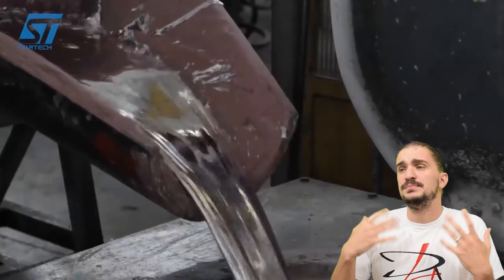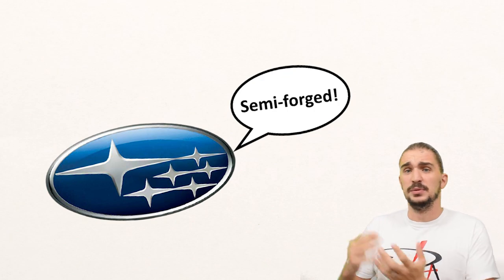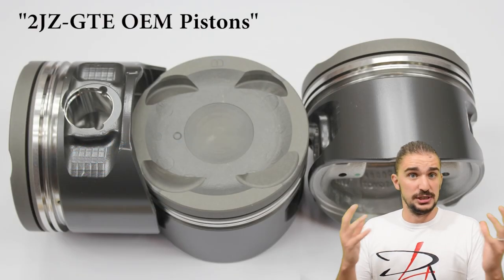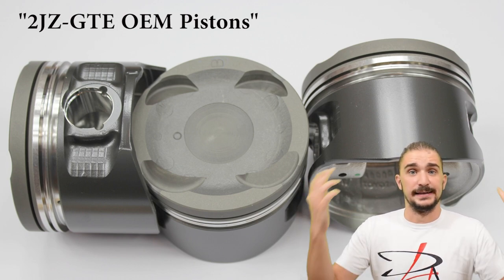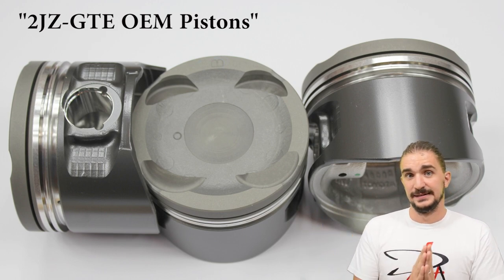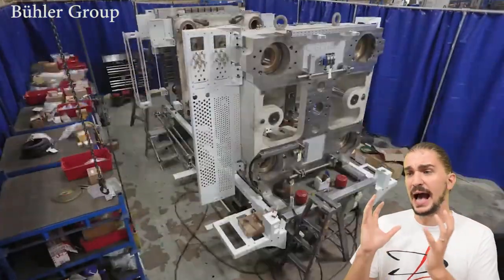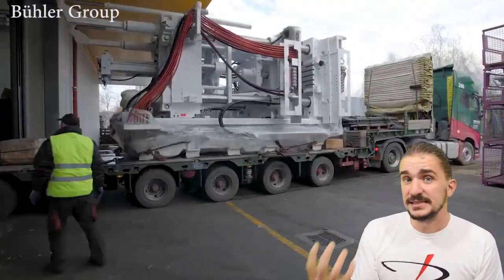Many hyper-eutectic pistons cast using high-pressure casting are often described as being semi-forged. This is an unjustified usage of the word, because the aluminum alloy is in a fully liquid state — it's simply forced into the mold — and although these pistons do exhibit many properties that are better than a classical gravity-cast piston, there is absolutely no forging going on. The term semi-forged keeps being used for these kinds of pistons. It's very common in the Subaru community, and many people also call the stock 2JZ turbo engine pistons semi-forged, when in reality those are hyper-eutectic cast pistons with zero forging. OEM manufacturers often have very strict, very high quality control, resulting in very good pistons.